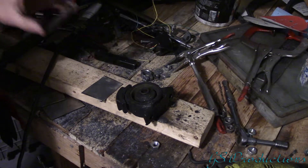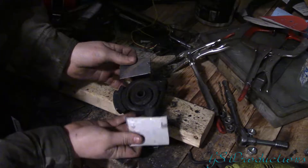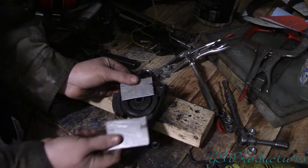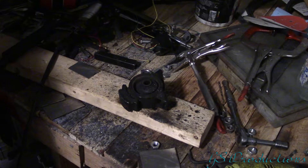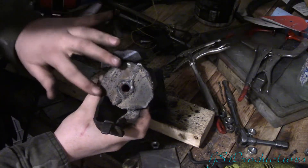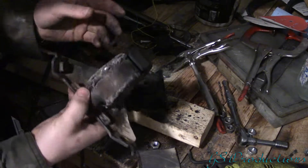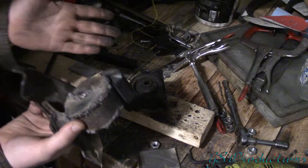The next method uses just pieces of scrap metal of various different sizes. You can overlay them where the bolt holes will go, trace out where you'll need to cut a half circle, then trace out the excess to trim off to complete the overall circle and weld over it. Here's one that's complete — there's a line straight through where the pieces meet and a half circle, and the pieces are all kind of jagged because I used random pieces lying around. It's a really good method especially if you don't have a step drill bit. One of the easiest ways to do this.